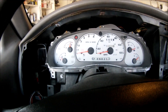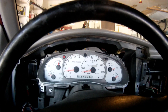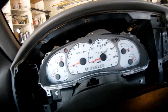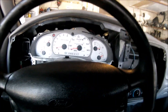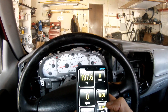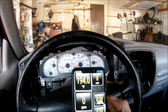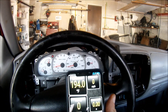What is going on? The truck is about to blow up? Nope, that's not the case. Let me show you the real temperature of the engine. I'm going to use this BAFX Products OBD2 diagnostic interface — plug it in. The data is showing 197.6 degrees Fahrenheit, which is a normal temperature for these engines. At 194 degrees the gauge is still pegged and the check gauge is on, so that's not cool.